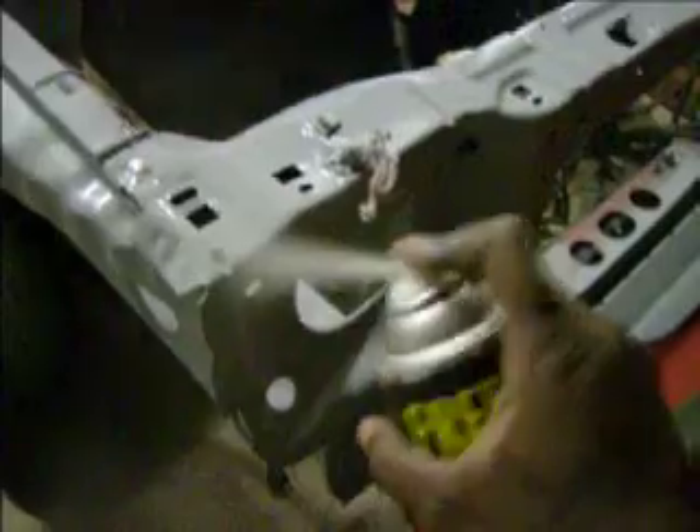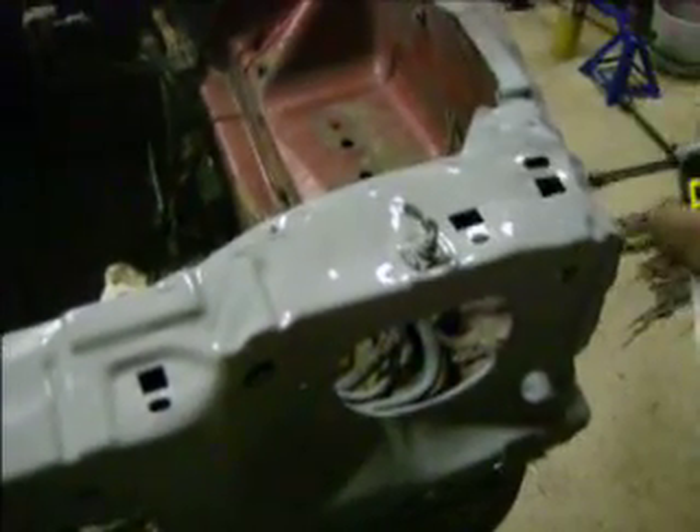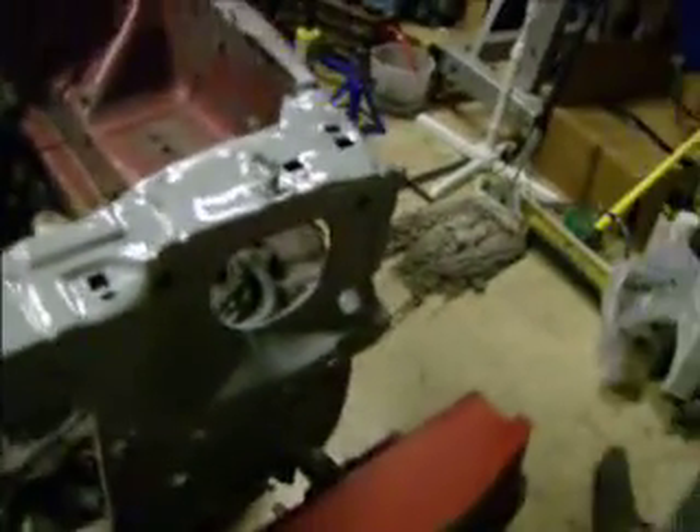The whole goal of this is to put up a workable layer of paint that you can sand to your heart's desire to get the finish that you want. For me, I'm going for a painted engine bay finish, not showroom finish. Long, steady sweeps at a constant pace so you don't get big drips. My overlap is literally about 70% because I want a nice thick coat to work with.